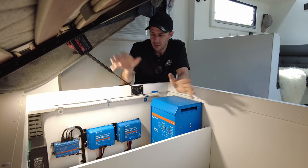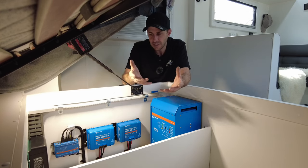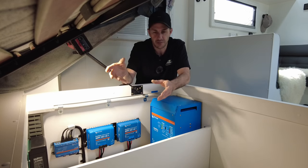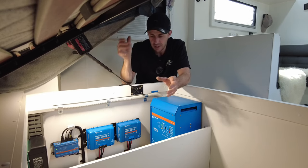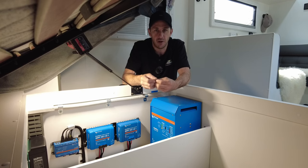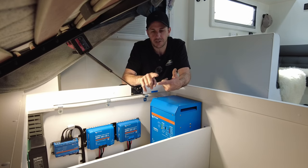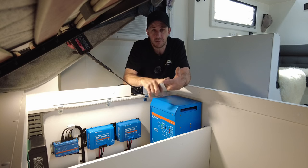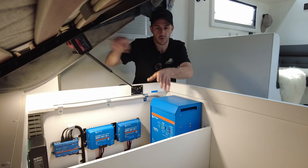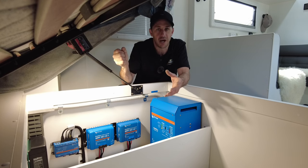Now this DC charger, we've got the Enerdrive 40 plus DC charger. The reasoning behind this is the customer's got a BT50 and he's already got a dual battery system on that, so he's sucking a fair bit of energy from that alternator already. He doesn't have his vehicle with him, so I'm unable to inspect the existing Anderson plug on his vehicle, so I don't know what gauge of cable it is. With a 50 amp or 40 amp charger, 6 B&S is the minimum requirement, direct from the starter battery. If you don't have that gauge cable, because that's what we fit through the drawbar, the charger just won't kick in and hold that charge.